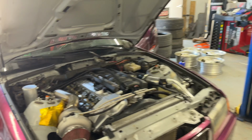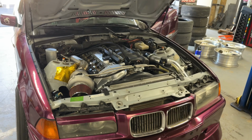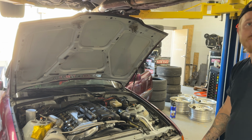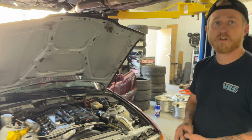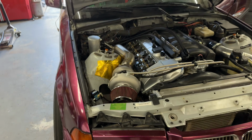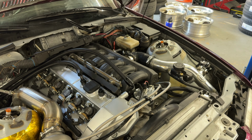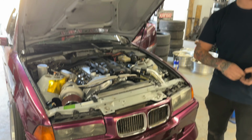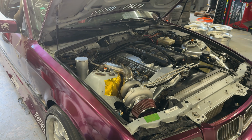Cool. I think for now, if we can, we should bypass the Mac valve. I always tell customers to do that and just run wastegate pressure, but I don't know how doable that is. I guess on the ECU, you would just check it on or off, right? Yeah, leave it off for now and then make sure it's running our spring pressure and kind of go from there. Make sure we set a boost cut beforehand, set all the safeties first. I'll make sure that's set up.